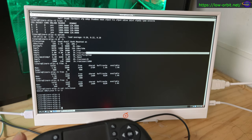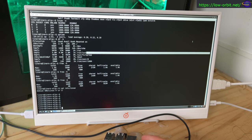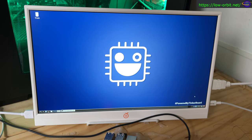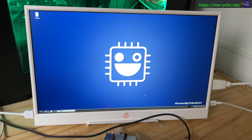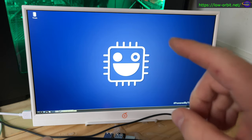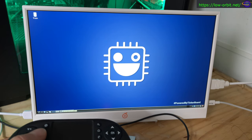One other thing to note: Wi-Fi was pretty easy to set up. I didn't fiddle around with the command line at all. We basically just used the GUI — clicked on my wireless access point, typed in the password, and it was good to go. So I set up Wi-Fi, got online, had to get the time synced via NTP so the correct date was set and SSL would work, then fiddled with audio so I could watch YouTube videos with sound.